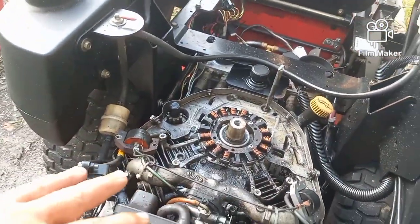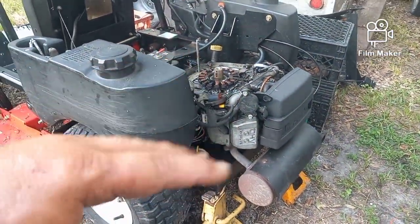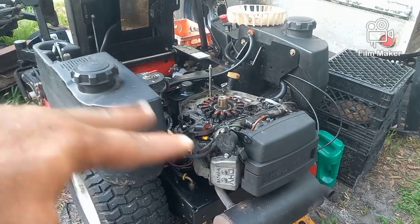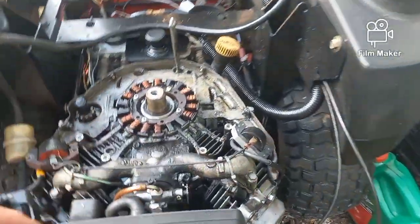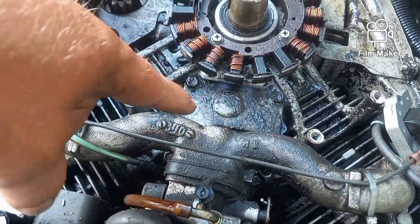The second problem is, and I don't think that it's an issue, is where the case, the crankcase, comes open. You crack it in half to get to everything inside, and you'll see that later as well. But I didn't see oil coming from anywhere around there, but you can't see everything. It could be leaking from anywhere. Clearly it's coming out of here, which means it's coming out of this oil filter system up here, this case.